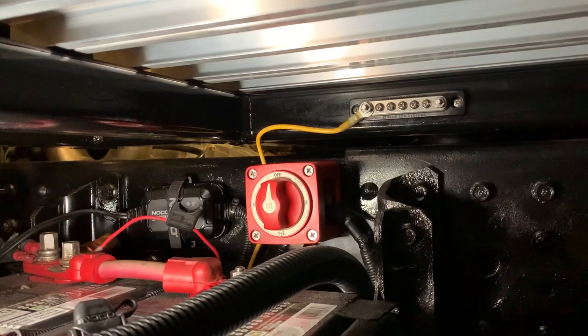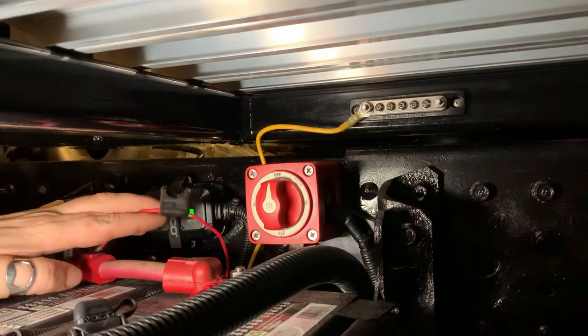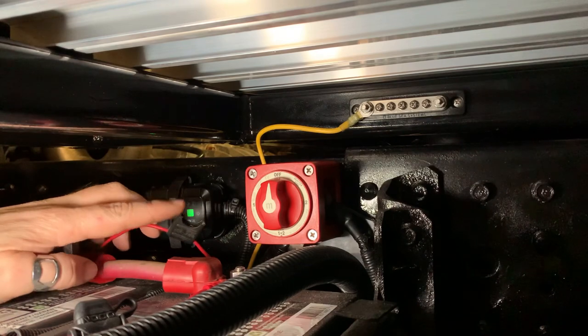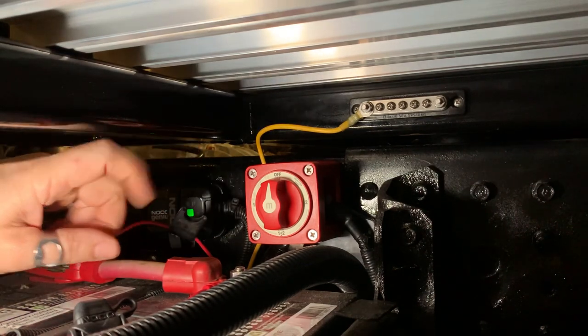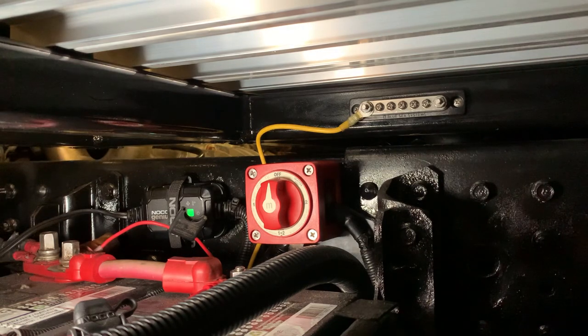To make things a little bit easier up at the battery end I've added a single inline fuse — this will have a 10 amp fuse in it to power both lights. I've also installed a ground terminal strip so that accessories I wire up for this flat deck can connect there with only one wire running to the battery negative. That small lead is somewhat temporary; I will be installing a fuse block at a later date to power multiple circuits for the tray back.